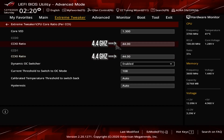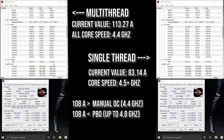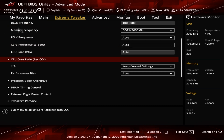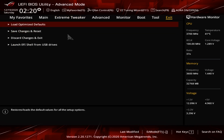Now that you have a better understanding, I'm using a CCX ratio of 44, which is 4.4 GHz on both core groups, and I will now enable my Dynamic Overclock Switcher. This allows me to switch between my manual overclock and Precision Boost Overdrive. My threshold for switching is 108 amps. If my workload goes over 108 amps, my manual overclock will go into effect. If my workload is less than 108 amps, Precision Boost Overdrive will stay in place. I keep it at 108 because when running a heavy multi-thread workspace I go above that, and when gaming I usually see it beneath 100 amps. Now that we're done, go ahead and exit, hit Save Changes and Reset.